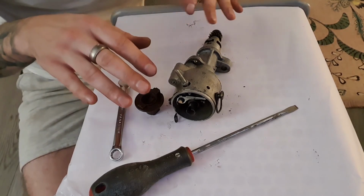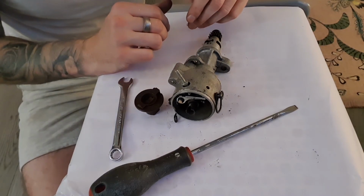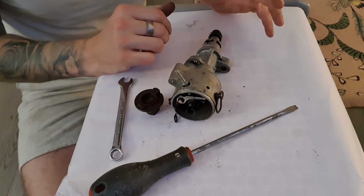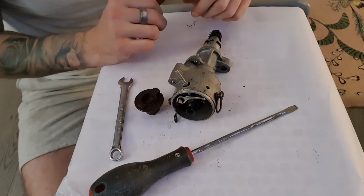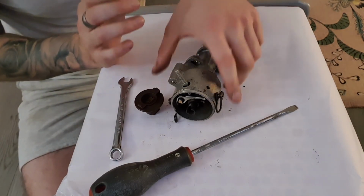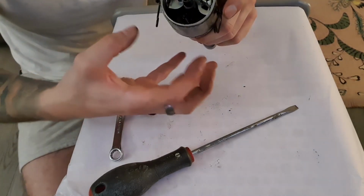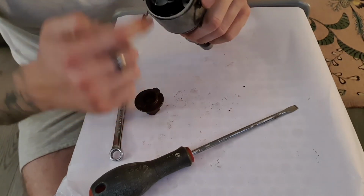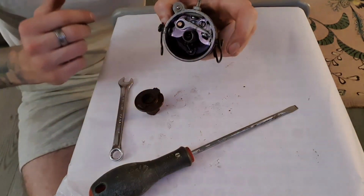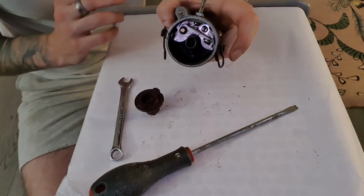So this is pretty much applicable to any of these styles of mechanical advance distributors only, so Bosch 009s, the people using Volkswagens, obviously these Marelli units out of the Fiat 500s. It's a slightly different setup if you've got a vacuum advance, because if you have a vacuum advance as well as the mechanical weights plates, there would be a vacuum unit on the side here, which would have some form of hook that connects the advance plate, so the timing can be advanced either via vacuum or via mechanical, or a combination of both.